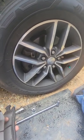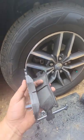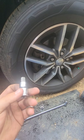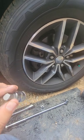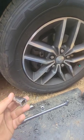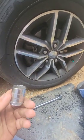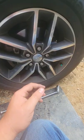Today we're going to be changing out the brake pads of a 2017 Jeep Grand Cherokee. What you'll need is obviously new pads — this is the inner one and that's the outer one. The important thing you will need is an 11 millimeter hex. None of my local parts stores carry this; you may have to order online or go to a big parts store. My local AutoZone, Napa, and Advance didn't carry it. You can't use 7/16 — the 7/16 is slightly bigger. You'll also need it for the caliper pins. You'll also need a 22 millimeter socket for your caps.